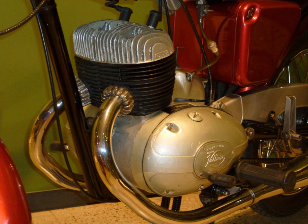In a 270-degree engine, one piston follows three-quarters of a rotation behind the other. This results in a cancellation of the secondary free-force imbalance, but not the rocking couple. The primary imbalance is a combination of free-force and rocking couple, mitigated by use of a balance shaft. It yields firing intervals identical to a 90-degree V-twin: cylinder 2 fires 270 degrees after cylinder 1, and cylinder 1 fires again 450 degrees after cylinder 2, totaling 720 degrees. The harmonic contribution gives a pulsing feel more like a V-twin rather than the 360's thrum or the 180's throb, and the same is reflected in their respective sounds.